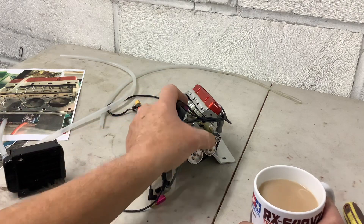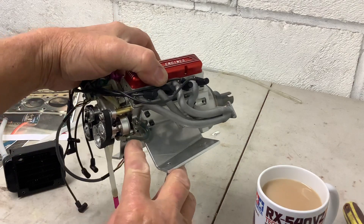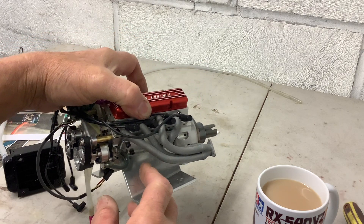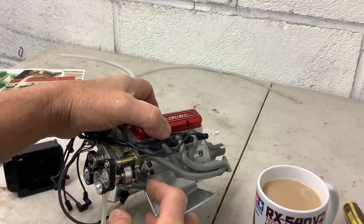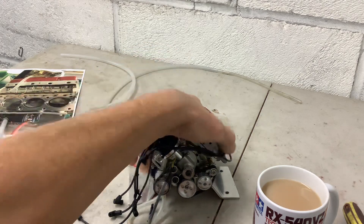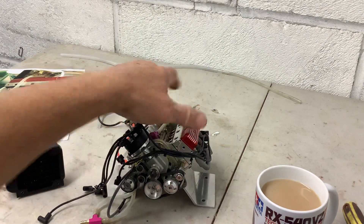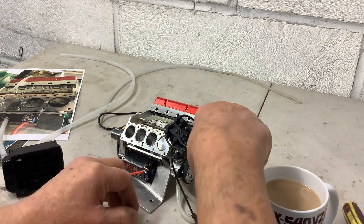It was emptying the oil out of the exhaust so quickly that I was getting air bubbles in the oil pump, where it was using the oil up so much. They don't hold a lot — it's about 28 millilitres I believe — and as soon as that dropped a little bit, you started getting air bubbles. When I put my hand over the exhaust, it was spitting out oil like a glow plug engine. I couldn't believe my luck again buying a Sterling Kit engine.